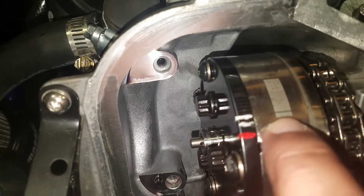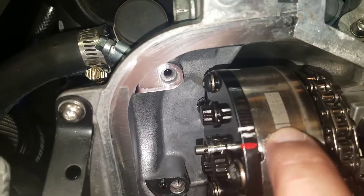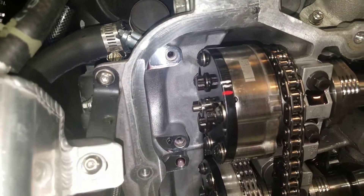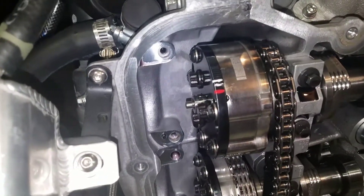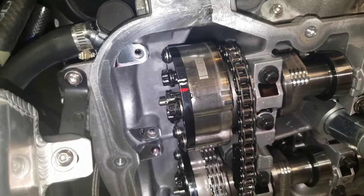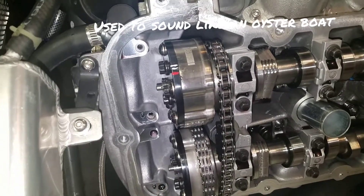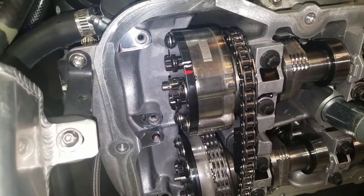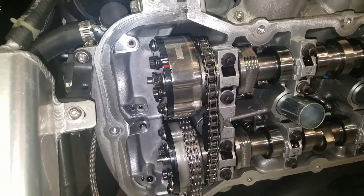This white mark is where I advanced them to, which was somewhere around 108 to 110. I'm going to back it off three or four degrees on each intake cam to see if that helps. My cylinder pressure was much higher — it went from about 150 average to 180 average — and it definitely had a really choppy idle. I just want to take some of the cylinder pressure down and hopefully extend the RPM range.